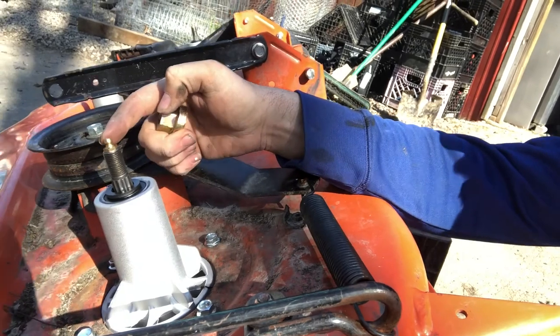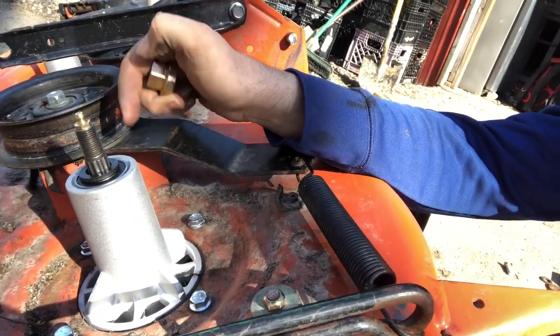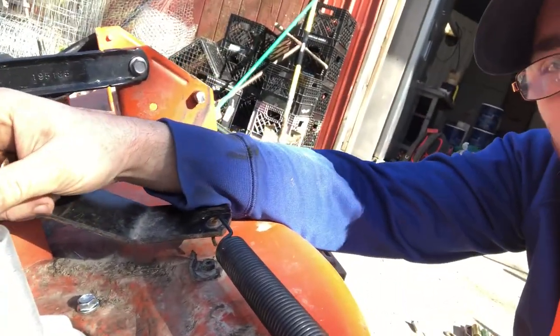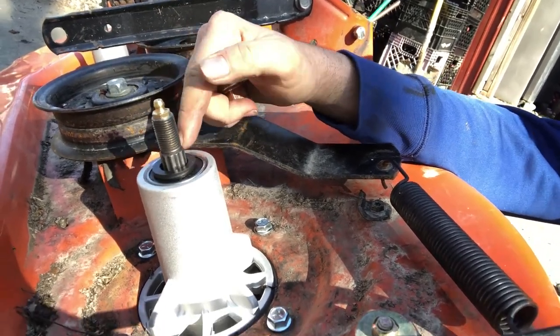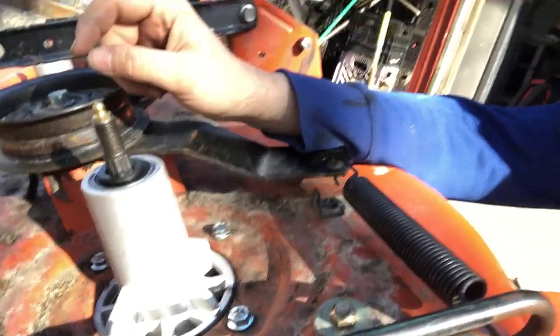And as you can tell, there's a little difference. You can see these little nipples. It's a grease thing for the spindle itself. A couple of them had sheared off on my last one, so obviously, you could tell I hadn't done it the right way. But like I said, this is how we do it. This thing comes with a washer here and a nut. Take the nut off, leave the washer on. It has to sit on the spindle, on the bearing. Otherwise, it'll shear everything and it's all shot. And you get to do all this all over again, just like I did.